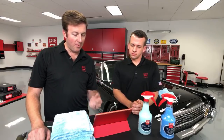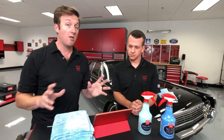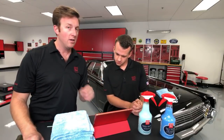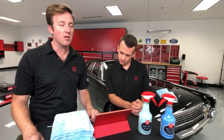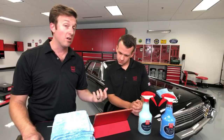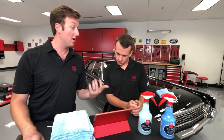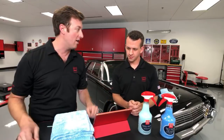Getting a few compliments about the Boss correcting cream and fast correcting cream. Those are our more aggressive abrasives within that Boss cream line. Amazing products, long buffing cycle, can be used with long throw machines and do cut a lot of time out, and they do finish down pretty gentle, so it can eliminate the need for polishing, jeweling, secondary steps. So thank you for those compliments, guys.